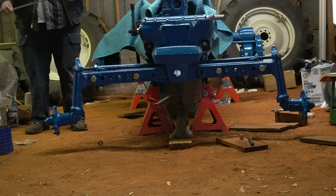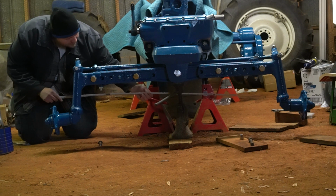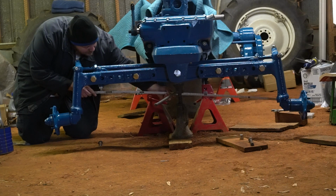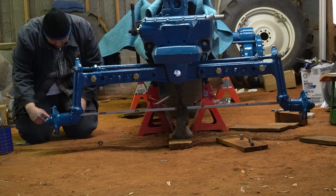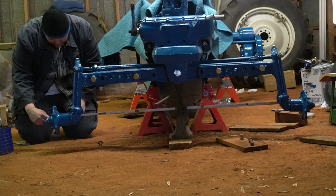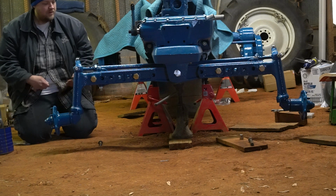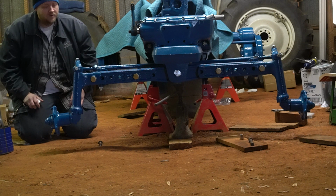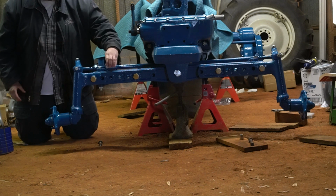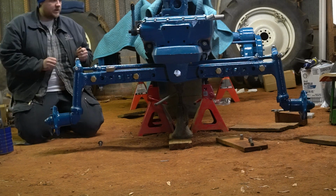Then we're going to go to the rear. And the same thing, just hook the hub right in the center, come over here, and I'm showing 62 1/16. So I have 1/2 inch of toe in right now. But like I say, I want that a little less since I don't have the wheels on there.